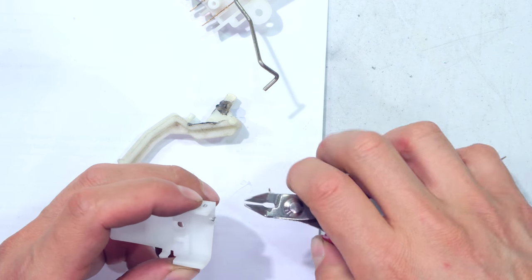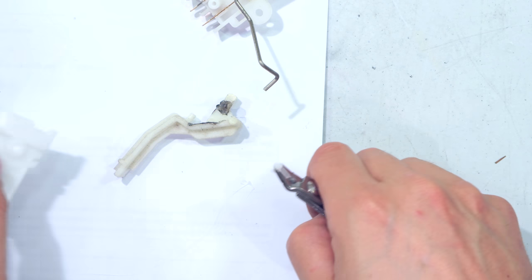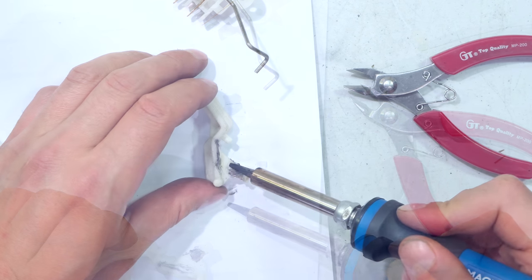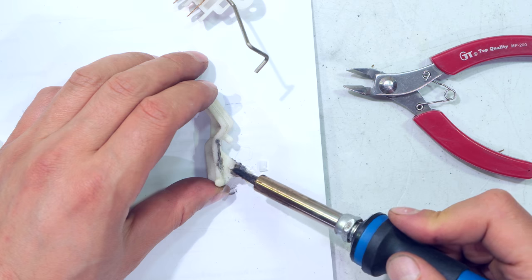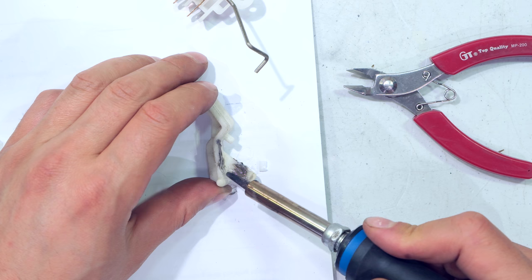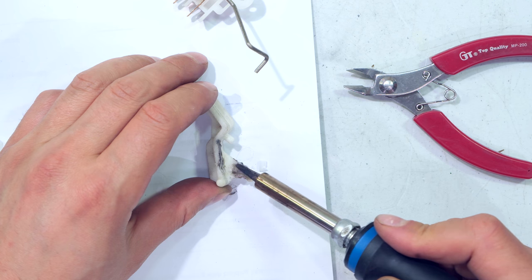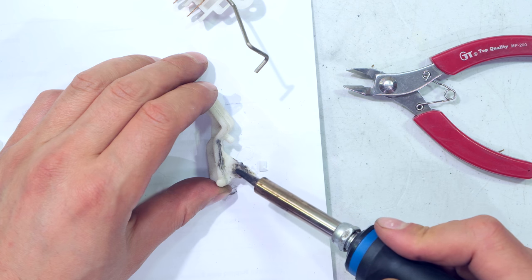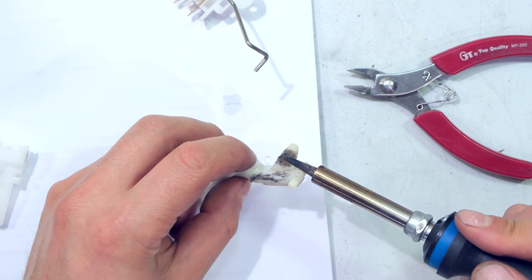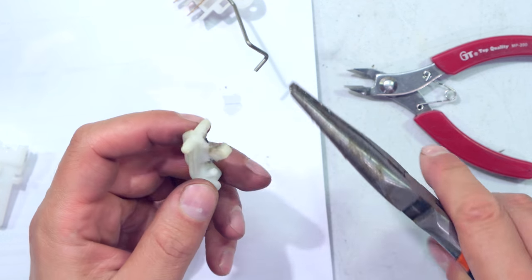I'm taking small pieces of plastic stolen from the lid using side cutters — three pieces — and melting them into the existing plastic, swirling and mixing with the soldering iron, then reforming the shape. This is better than super glue alone because super glue is brittle and will break if bumped. The plastic welding creates a much more durable bond.